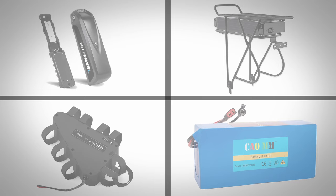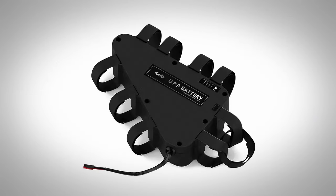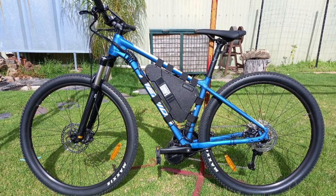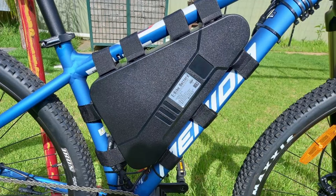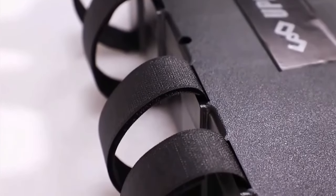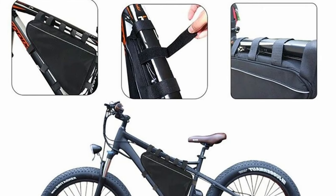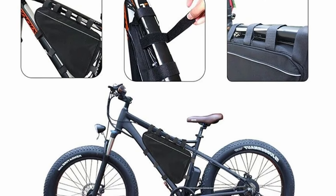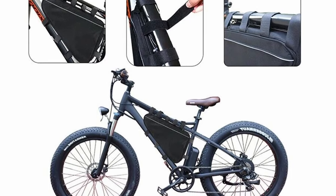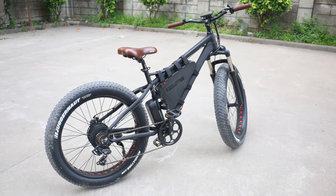The third most common style of secondary batteries comes in a large triangle-shaped casing. These are great for the large open areas common in many standard bicycle frames or moped-style e-bikes. These batteries fall between permanent and removable since they are usually fastened with several velcro straps, so taking them on and off the bike is a bit cumbersome but not impossible. Since they attach with straps, the amount of modification required to mount one is relatively low, but that does mean it may be more noticeable.